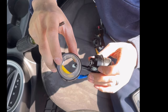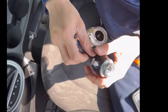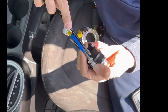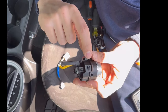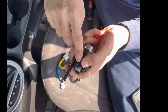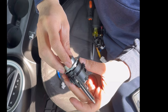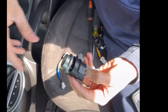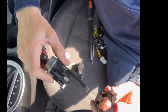First I want to remove this cylinder light — the indicator that helps you see the key at night. I'll put that aside. There are two rubber grommets in here that we want to take out. Take out the first one and put it aside — make sure you don't lose it. Now we're able to get this sleeve to slide out, though it still hits this pin, which only goes down all the way when you have it in accessory mode. Now we've got the sleeve off.